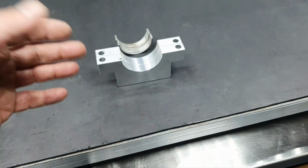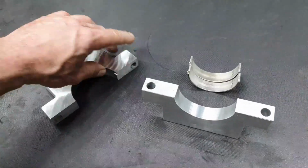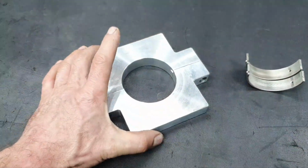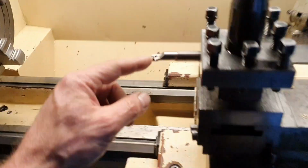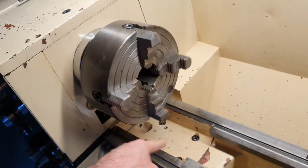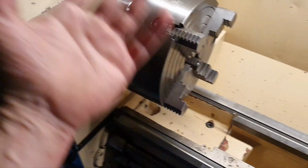You know what's the irony? I prepared the lathe because I said, okay, I make it undersized, it's not gonna be okay, and I was willing to grab it together and put it on the independent chuck. I'm gonna show you outside. I even changed the chuck on the lathe. I removed the 3-jaw chuck. I have the boring bar here and the 4-jaw chuck, the independent, to grab it here and fix the bore inside, but no need.